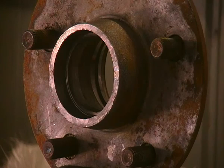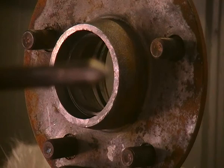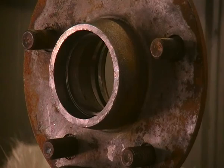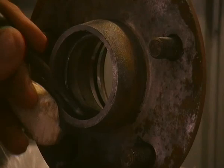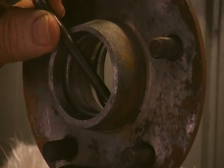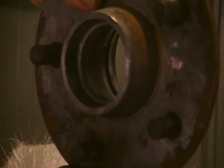There is another way you can do this — I'll still probably get the Loctite anyway — but you can take a center punch, a nice sharp one, and center punch some little dots around the inside of the bearing housing. That gives you a bit of metal to work with so it grips. We'll give that a go. I do not recommend this for cars.